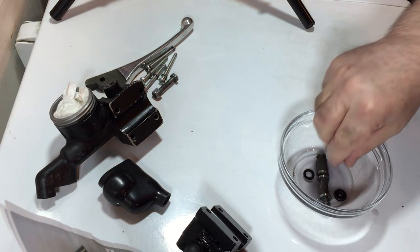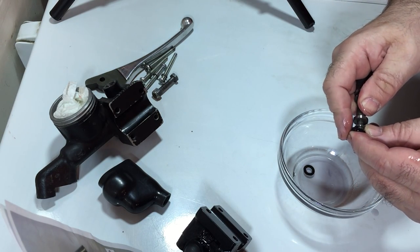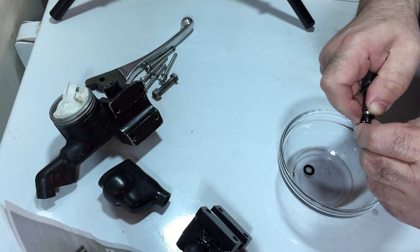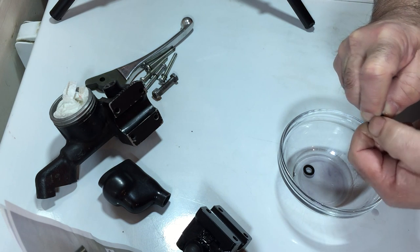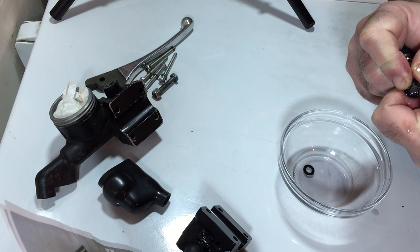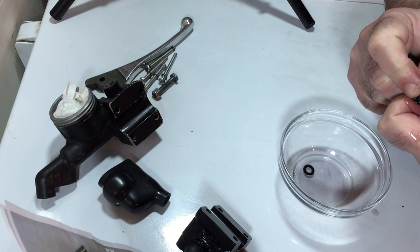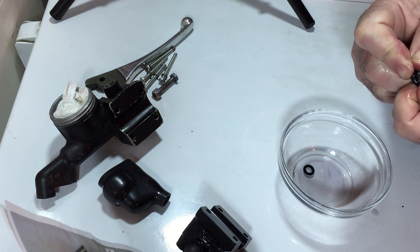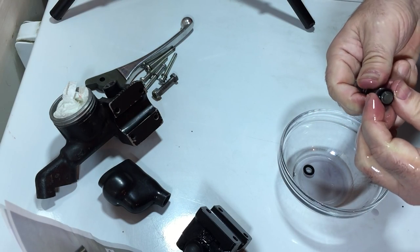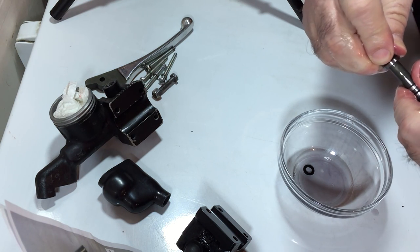It's been about 15 minutes and the washers have thoroughly soaked. Here I'm fitting the primary cup washer over the end of the piston. It's a little tricky — I did try using disposable gloves but they were slipping all over the place, so I took those off and I'm doing it by hand, just pulling and rolling it over the end of the piston until it seats into the groove, and you'll hear that click. Then just spin it in my fingers to make sure it's seated properly.